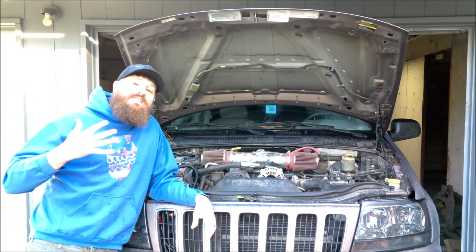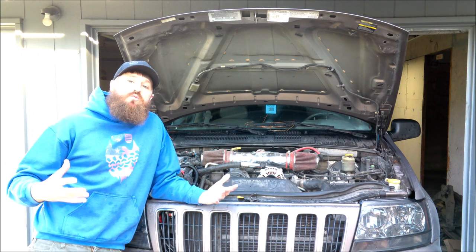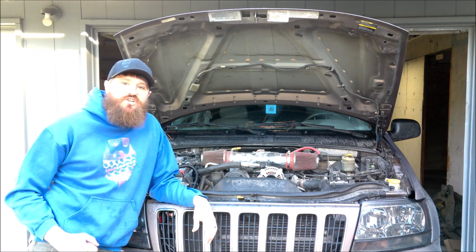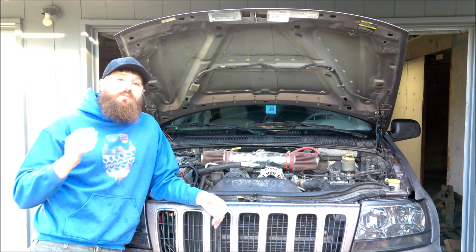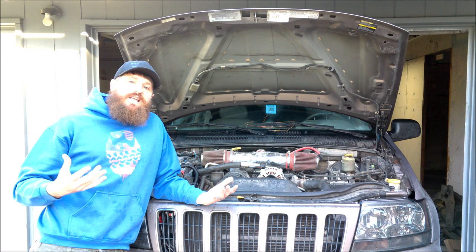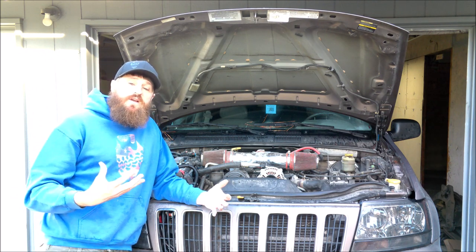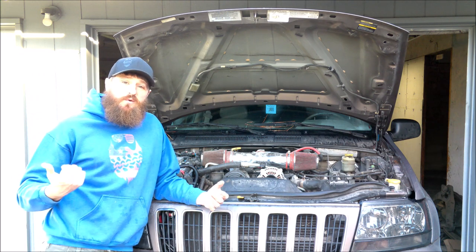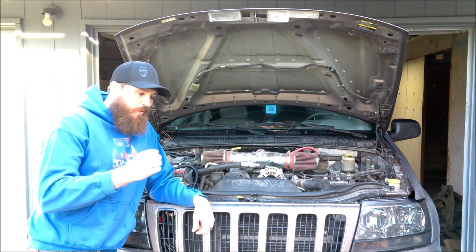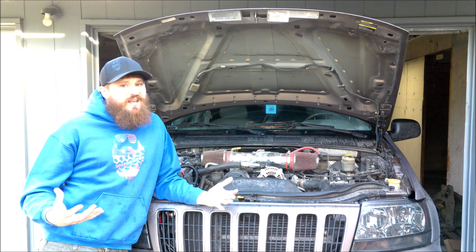I am Robbie and today we are working underneath the hood of my 2001 Jeep Grand Cherokee WJ, which I am calling the Trail Plush. Now, if you are a fan of this channel and have been following along with this build, you know that I bought this Jeep for cheap because it had an audible engine knock. I got really lucky and found out that a lifter had failed and kicked a rocker arm off. So I replaced that lifter, or valve lash adjuster, popped the rocker arm back on, and this thing has run mint ever since.